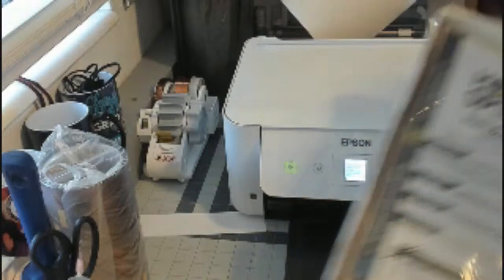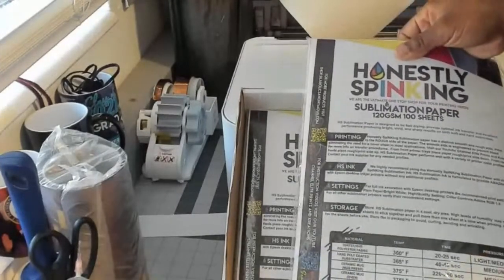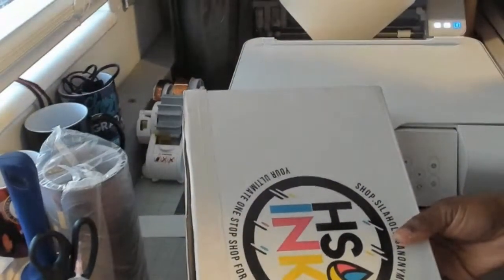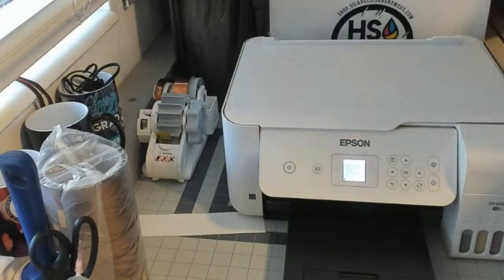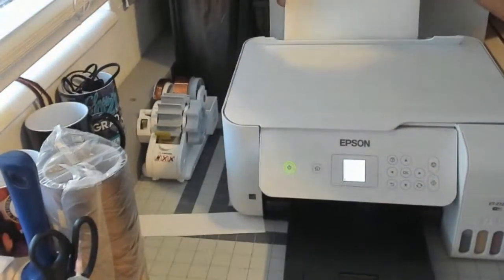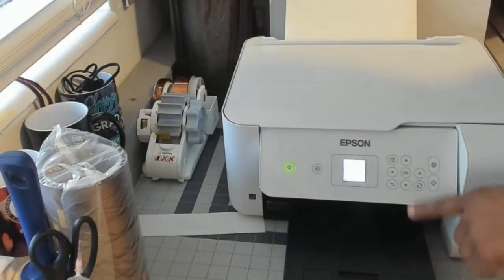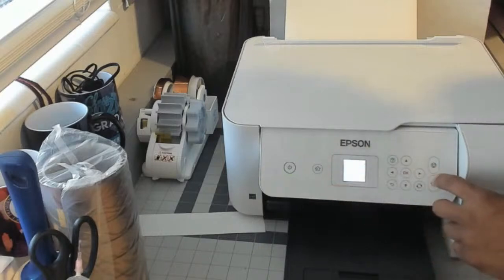All right. Let's switch over to this cam. It's a brand new bag. So with this, same thing. Rough side is your print side. You're going to put your print side in your rear feed. I'm going to lift up the back so that it has something to rest on. It's going to give me a paper mismatch again. So I'm just going to hit proceed, go down to change setting, hit OK. It will be changed, load your paper, and print.